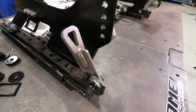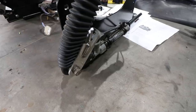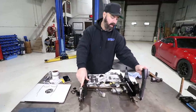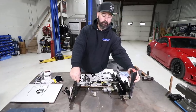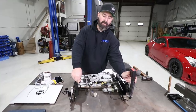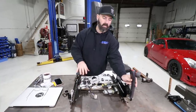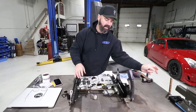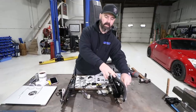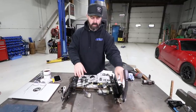We've also picked up their optional lap belt mounting points for a harness system. This hook here is for the lap belt to snap on on one side. On the other side there's the factory seat belt, which you'd be able to use in a coupe, wagon, or sedan. Because our cabrio seat belts are on the OE seats, we're no longer going to be able to use this. So we'll go to a full-time DOT-spec four-point harness system in the car.